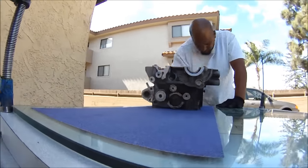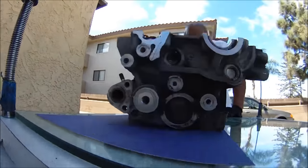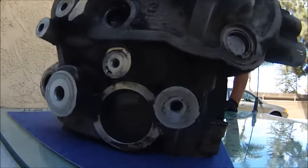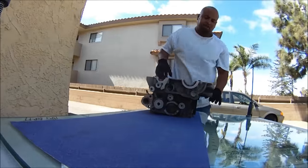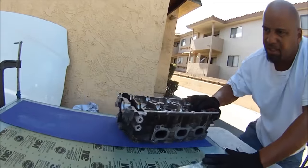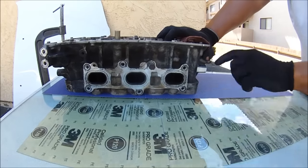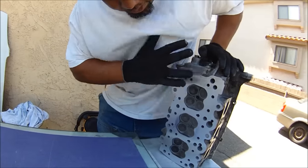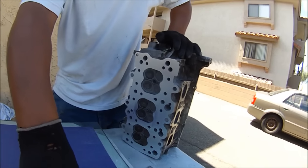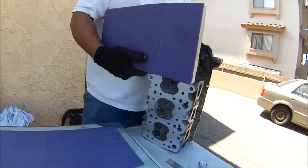All together, this job took about an hour and 15 minutes total. Is it worth it? You better believe it — save 45 to 50 bucks. I know it's not a professional job at a machine shop, but you do what you've got to do when you're broke. Go pick up the sandpaper at Home Depot — this is it right here, the 3M grade: 120, 100, and 80 grit. You start with the 80 grit in order to grind off as much as possible fast, because if you only use the 120 you'll be sitting here grinding for hours. The 80 grit cuts down your time.